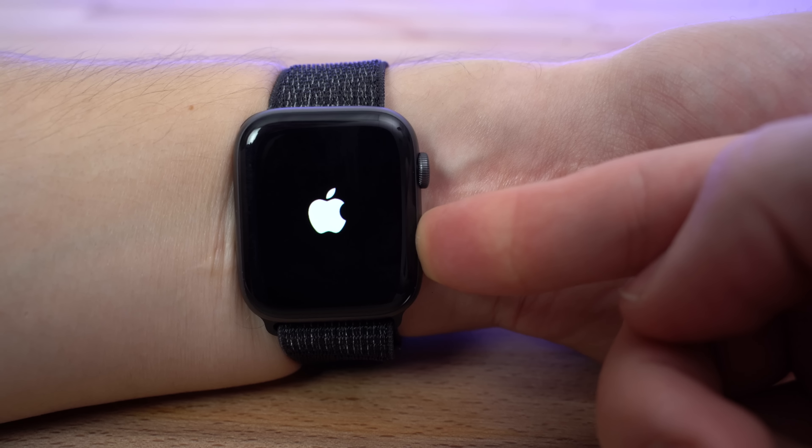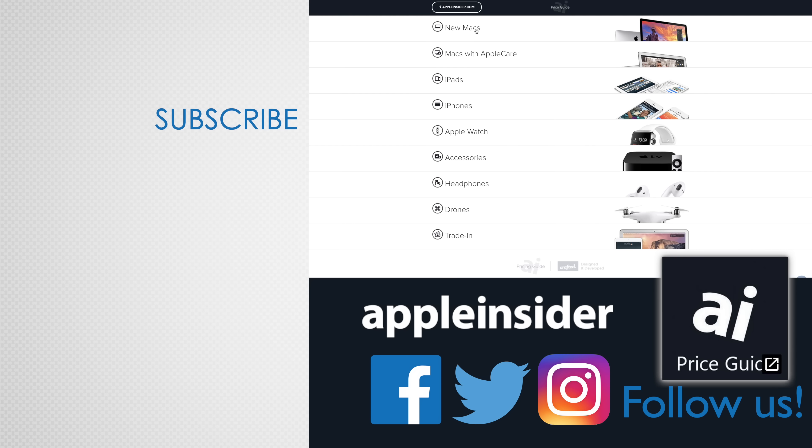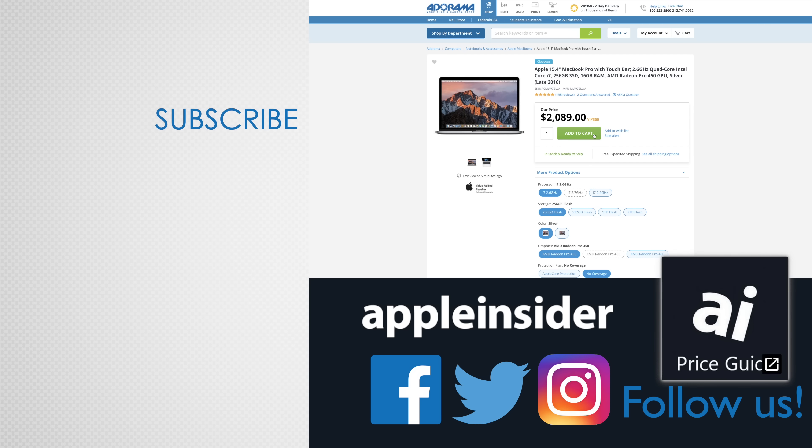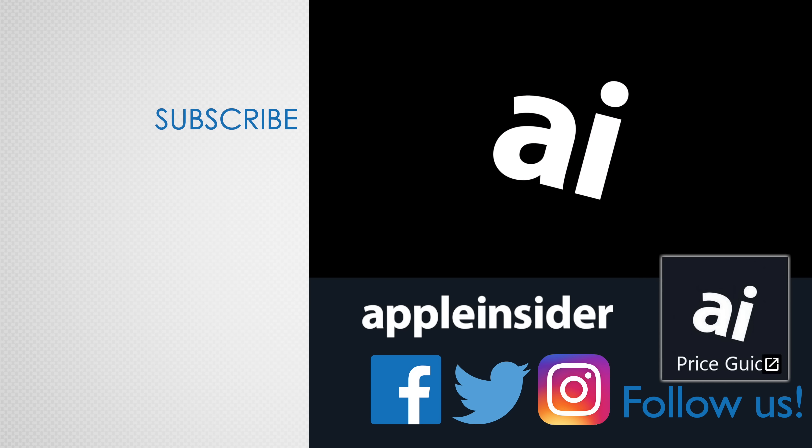To unpair, go to the Watch app on iPhone, tap the Apple Watch at the top of the screen, tap the eye icon next to your watch, tap Unpair and confirm. Then pair your watch just as you did when you first got it. If you're still having issues, check for any suspicious apps that may be causing excessive battery usage and uninstall them. Also make sure Bluetooth is always enabled on your iPhone, since having it disabled increases battery drain on your Apple Watch. Finally, there's Power Reserve Mode, which shuts everything off except for a clock, boosting your battery life significantly. To activate it, bring up your Control Center, tap the battery percentage, and drag the Power Reserve slider. To turn off Power Reserve, press and hold the side button until you see the Apple logo and wait for the watch to restart.